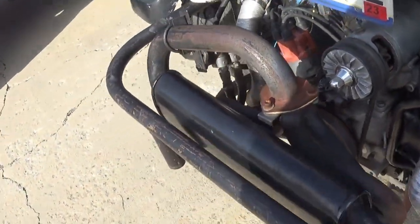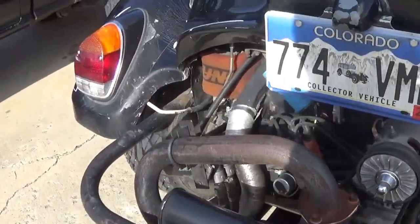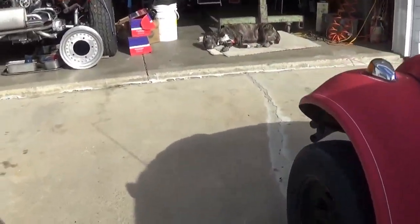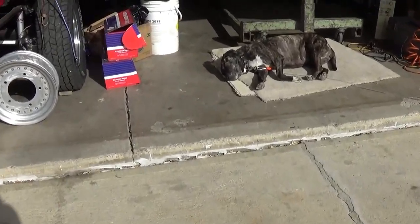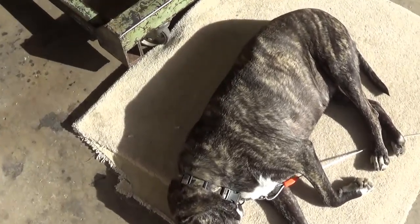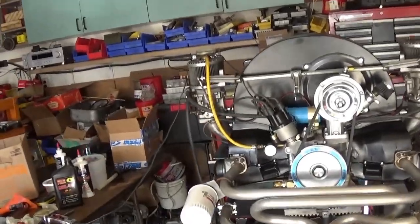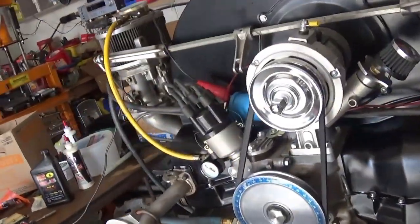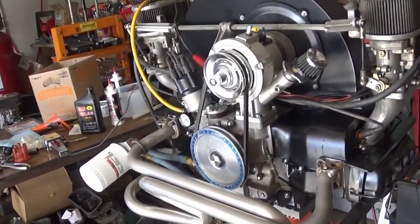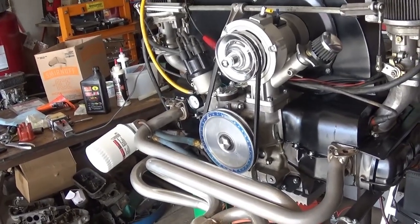This thing's an aluminum block and it's a 2 liter. That's my favorite. I think after all these years I can say that's one of my favorite engines. 1776 and the 2 liter. If I had to pick two out of the pile, I would say 1776 for a 69 crank, because everything fits. I know a lot of people favor those 87s, the no machine, make a 1641 out of it, but it is a thin wall cylinder.